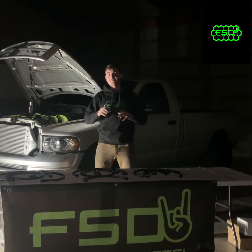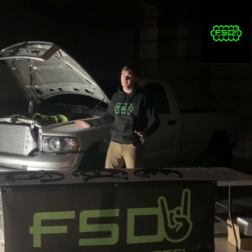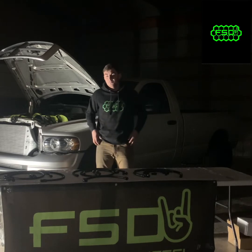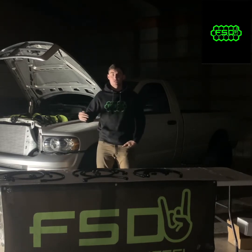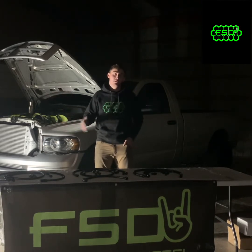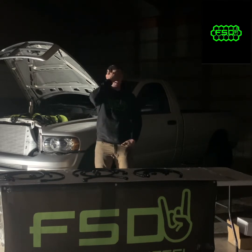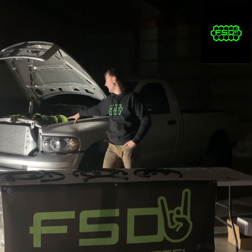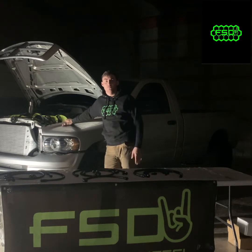It's not like driving it one time in the cold is going to destroy your transmission — I do it all the time. It's a risk, and not a good one. You'll basically see your transmission temperature not getting up to operating temp. If you start driving, you can get it up, but then you're risking rolling out seals and other issues. If you live where it's warm all year round, bypass it — it's a great option. You don't have to worry about the transmission, it makes your whole transmission live longer.